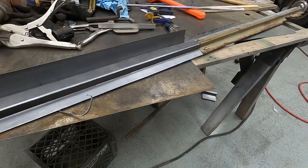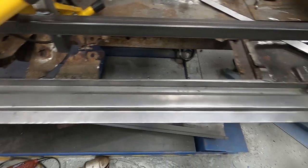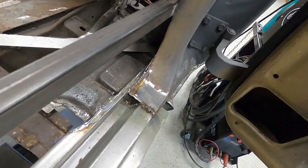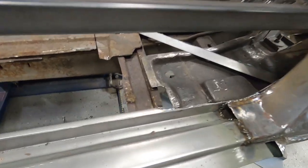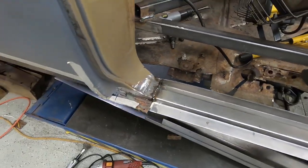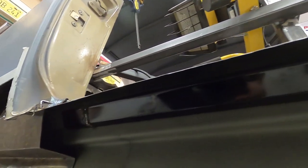These are available — let us know if you need a set. They're all bent to the 57/58 Plymouth factory bend right off this factory piece here. You get a full weld around it right there, attach it to the inner rocker there. You've got to go inside and cut the inner rocker down just a little bit after everything is shaped, then cut the lower cowl section out to allow for the new outer rocker to go on. The inner rocker and rocker top join up nice along the top.